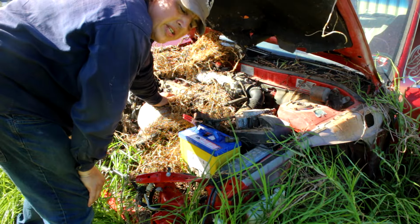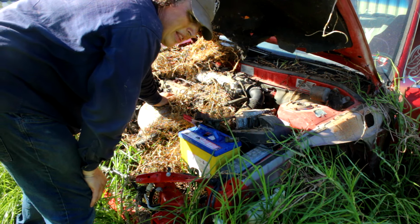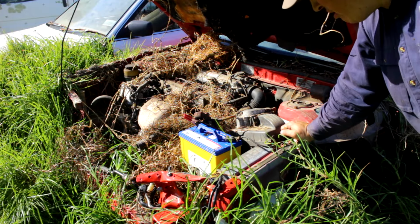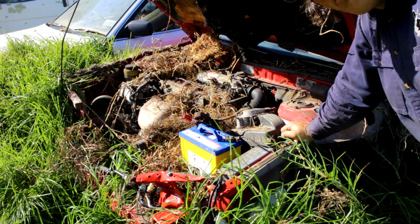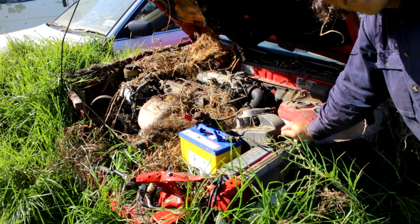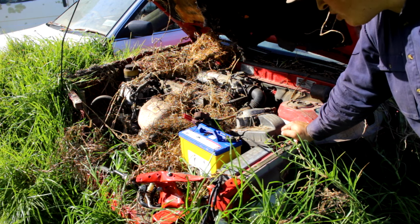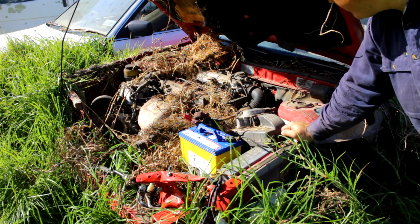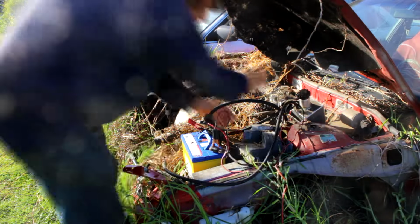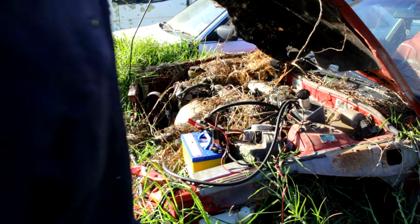The fact that the tank is half full and it's from 2015 makes me think that there's a possibility the fuel might be bad. Trying to decide whether I try to empty the tank or just top it up. I can't hear the fuel pump, so maybe I'll pull out the back seat and drop the fuel pump in a bucket. What could go wrong with a fuel pump in a bucket? Thought I'd give this one more go.